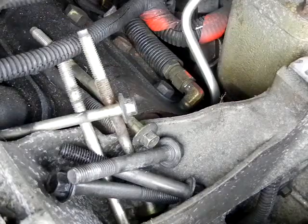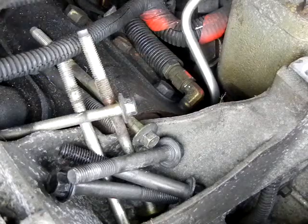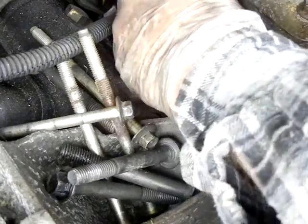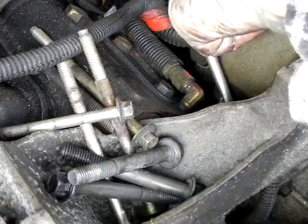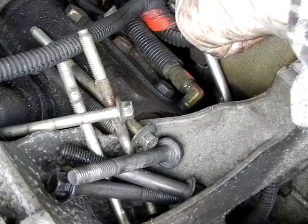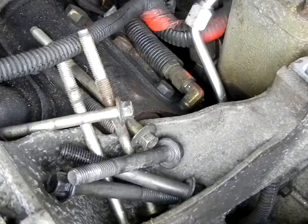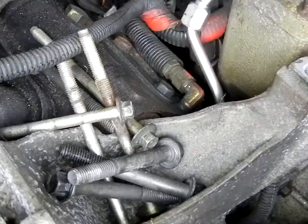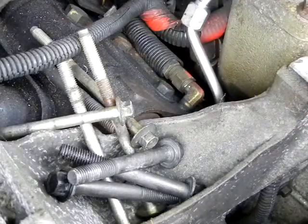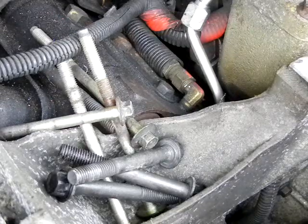So just grab a 5/8 inch wrench and take it right off. Now, don't just do this right here and hope that you can get by with that. I really highly advise you take this tube off and not bend or break it. Once you do, you either have to make one or go find one.